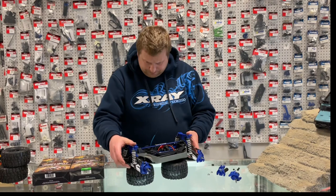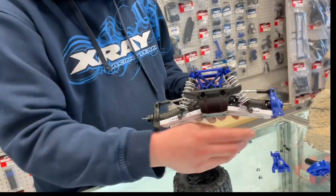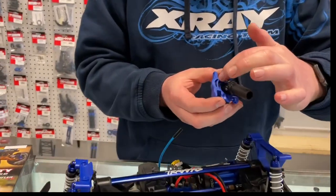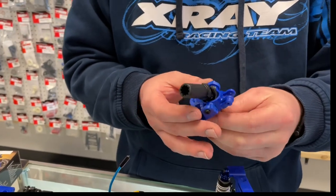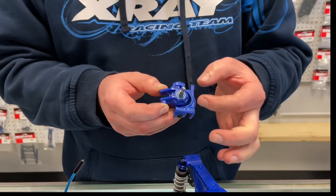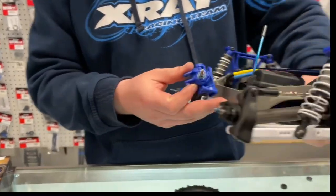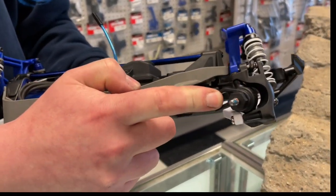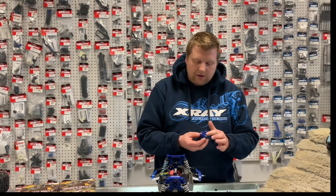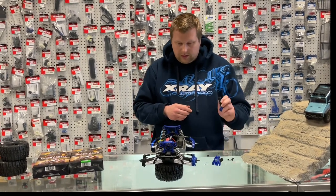And that's even what they did on the front. The caster block has the same thing — quite a bit more material, has an extra inner brace here so they don't just shatter that side, and it's way more bulky and beefy on the inside of that caster block as well. Way more material in here, so it should be quite a bit tougher. Going on to the steering knuckle — kind of the same thing — way more bracing and way more ribs throughout that outer side of the bearing to make sure that doesn't flex, doesn't have play, and you don't wreck that bearing. Way more beef when you look at the top of that steering knuckle as well. This is also what we think is coming in the cold weather plastics, just looking at the color and the shine in comparison to your standard steering knuckle or c-hub. So it should be quite a bit more durable and quite a bit stronger.